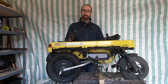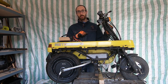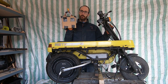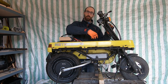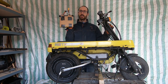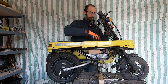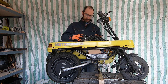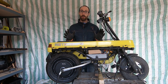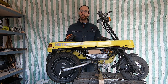What we've got to do now is make some brackets and weld them in. That's two out of our three big components fitted — the wheel and the motor controller. The next one is our batteries. Ideally I'd like to be able to pull the batteries in and out to charge them, so I've made this handy little carrier — we'll make it out of metal later. We now know roughly where all our bits are going to go, so let's start making some brackets and fine-tune from there.